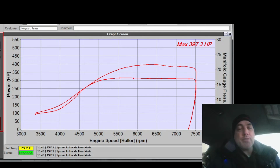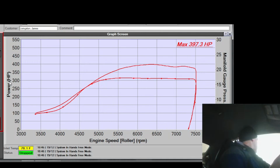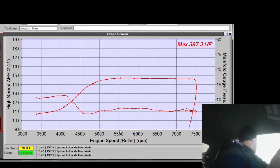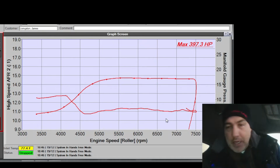All right. So, software crashed. I don't remember what I was doing at the time it crashed. What was I doing? Oh, yeah. I needed to add a smidge more fuel to that one area. And that was what? I said it was 55 to 65? Let me bring that back up. 55 to 65. Yeah, send it around 6. Add a smidge more fuel there, and then we're gonna put some timing in it.